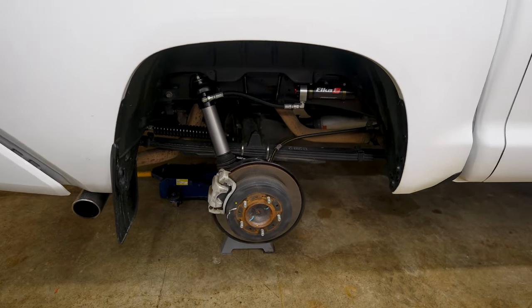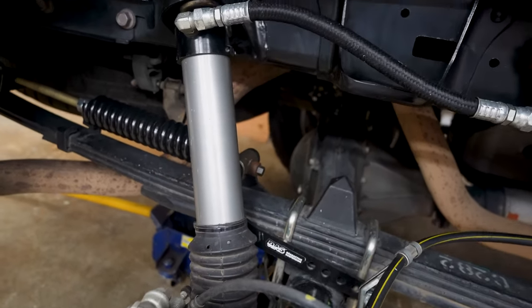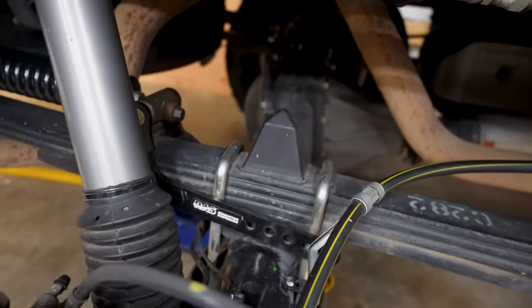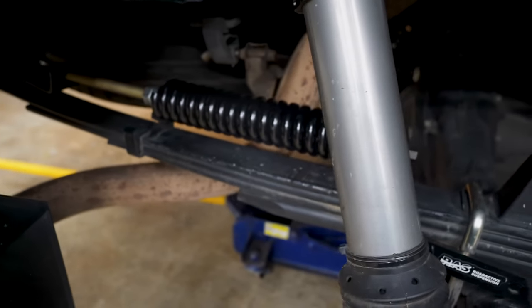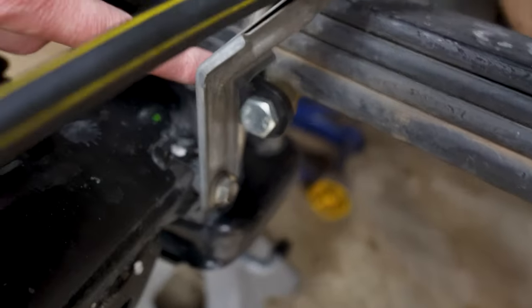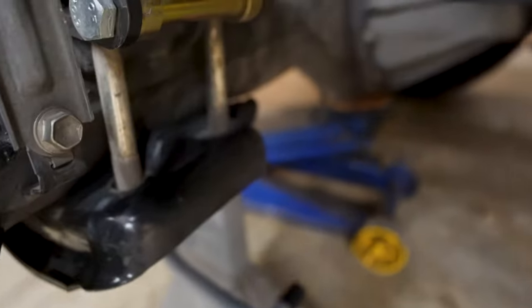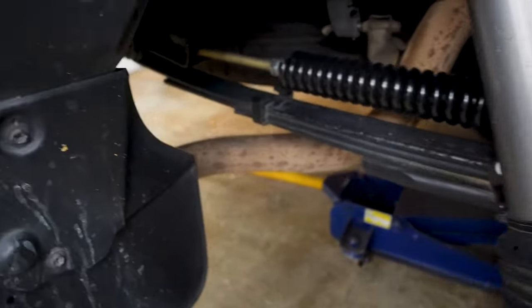I've taken the wheel off to get a better view. This isn't an installation video, but I'll show you a few unique things about my installation - remember yours might vary. I've got the HD kit. There are two offered for this truck: a standard and the HD. The HD just has a little bit larger coil. In other install videos there are multiple spots to place the bolt through, but on the Tundra in my case it would only go through that very last setting. You put the bolt through there with a couple of bushings in the sleeve. On the Tundra, per the instructions, it hooks to the shackle in the back at the bottom.